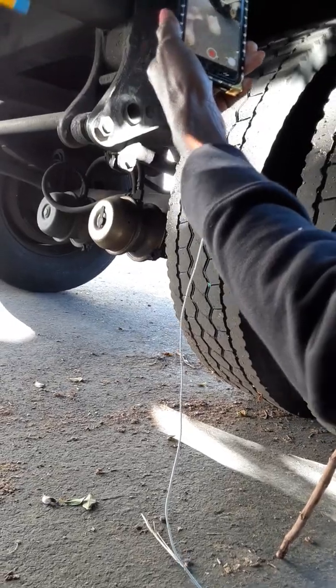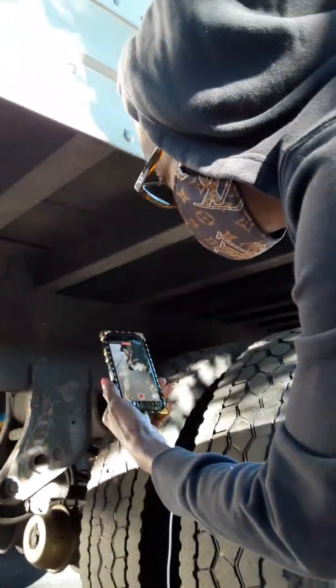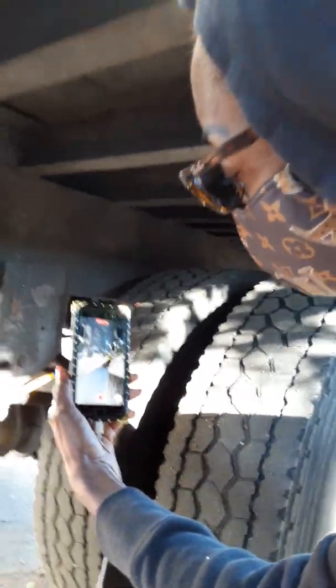Move on to my suspension. My spring mount, it is welded. I should have no cracks. My leaf springs and bushings, bolted tight. Bushings are not missing, should be well greased, no tears. My leaf springs should have no cracks or illegal welds and no swing.